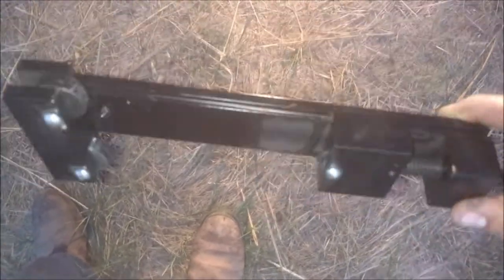I used my vise to hold it and applied pressure to get the filter turned so I could cut it open for the first time. It doesn't look too bad — it actually looks fairly clean. Let me flip on a light to get a better look. Filter looks good, that's good news. This is just the JEGS brand oil filter cutter — it works pretty good if you can hold the base in something. I've got to clean up everything, get that oil into containers to take to recycling, and then I can check the oil level.